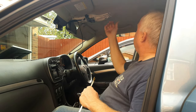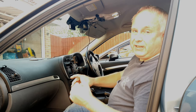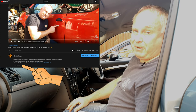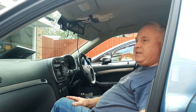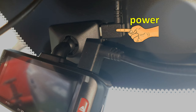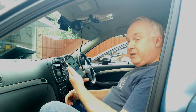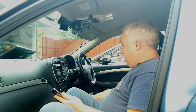If you click 'Show More' and expand the description below the video, I'll put links to tools, leads, and bits and bobs that you might need, as well as a link to this camera on the Zenfox website — worldwide delivery. The power supply plugs into the side of the base, which also has the GPS receiver in it, and the rear camera lead plugs into the top of the main camera body. Download and install the Zenfox app onto your phone and then apply power to the dash cam.